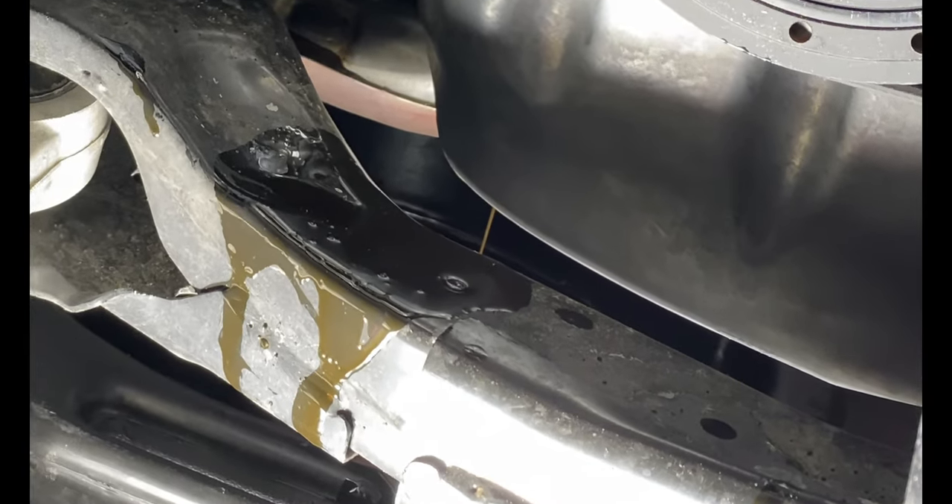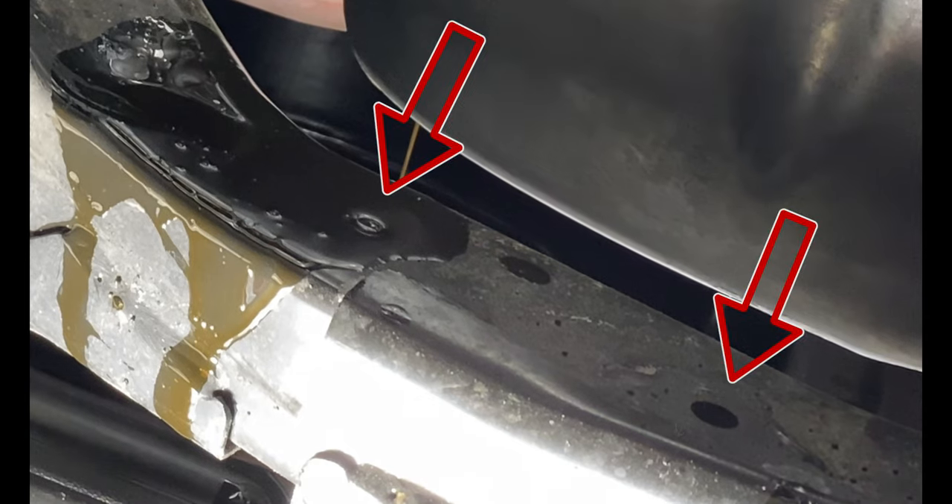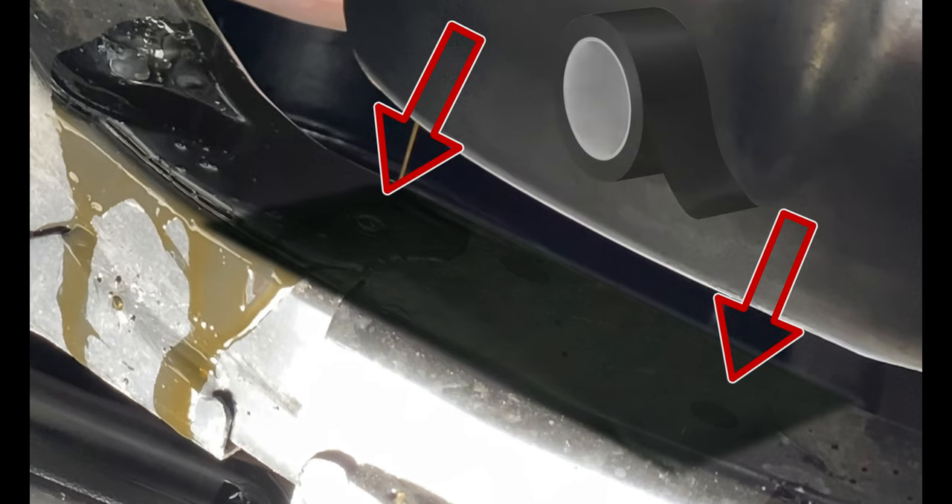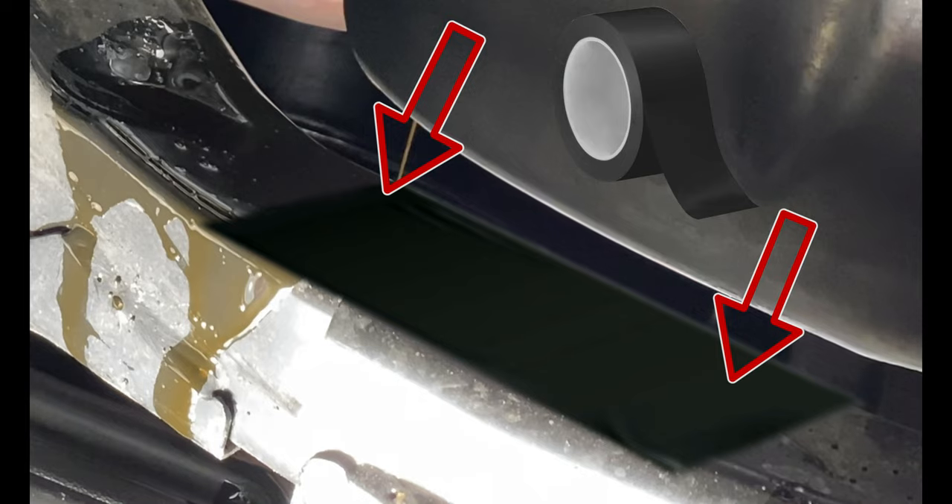You can see the oil drip down into the subframe through two holes as indicated by the red arrows. The oil will collect in the subframe cavity and due to the proximity of the exhaust, the oil will heat up and produce fumes which you could smell inside the vehicle. The oil will also slowly drip out past a clip holding one of the splash shields in place. I recommend placing a 2-inch wide piece of tape over these holes to avoid any oil from going into the subframe.